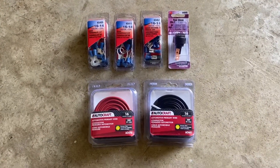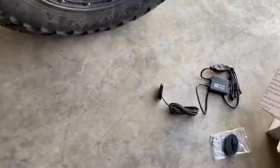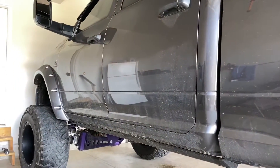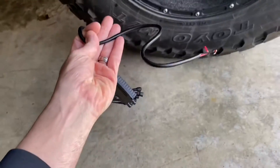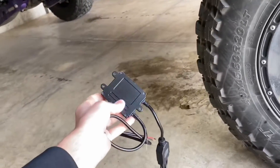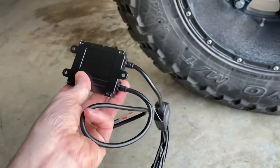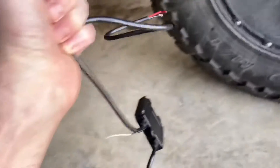I'm not exactly sure if I'm going to need it, but I have a feeling I will need the extra wire. A lot of these rock lights have lead wires that — especially from the back of the truck — might not be able to run all the way to the front engine bay. Most people want to put the module there because it has the shortest lead wire to the battery. I think what's going to happen is I'll mount the module somewhere under the midpoint of the truck, connect all my lights to the power cords, and run extension wire to the engine bay for power.